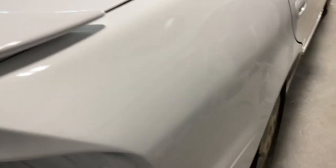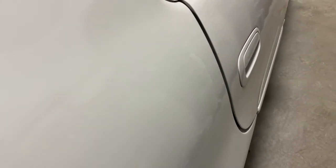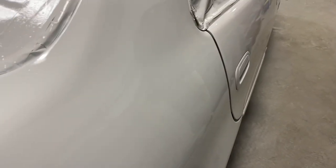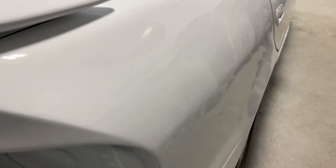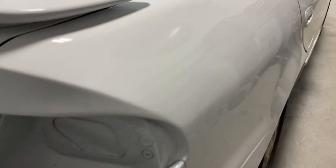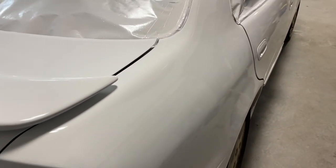Alright kings and queens, so here it is — the finished panel. Of course the whole car isn't done, but here's that section where we had the sags, and the sags are gone. So jump in those comments, tell me what you think. Is this something that you can do? I clearly know it is something that you can do. That's a simple, easy way on how to do it. Now the steps that you take might not be exactly as to what I did, but you will get great results. Hopefully this video on how to wet sand sags, runs, drips — all that good stuff — out of your finish on a single stage helps you out.